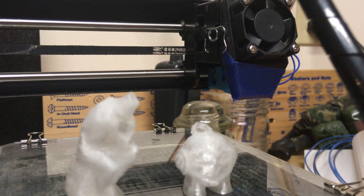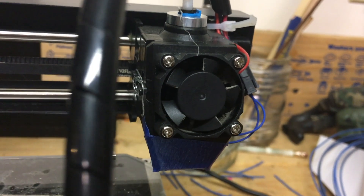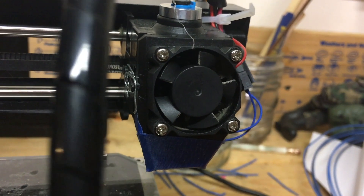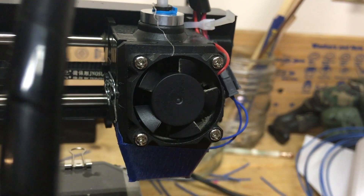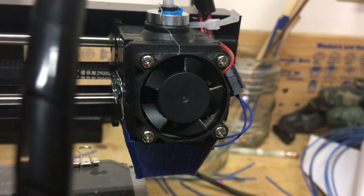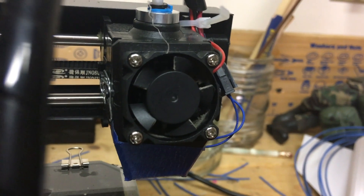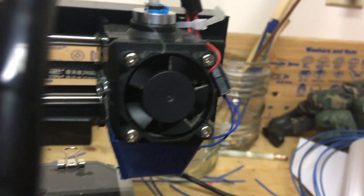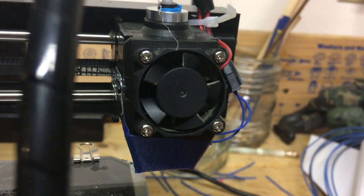So there are a few benefits of doing this upgrade. The one minor issue I have with this upgrade is the E3D hotend fan that it comes with. I opted out of using it — I just don't think that it's a strong enough fan for this. It seemed pretty weak when I had it on the hotend. So I switched it back out for the stock Monoprice fan, which seems to do a lot better. But that's really the only major issue I have with this upgrade. That's going to wrap up the video for this week. If you liked the video, make sure to click subscribe, and I'll see you guys next time.